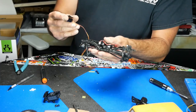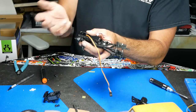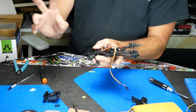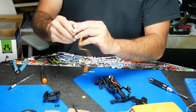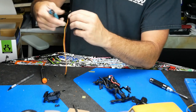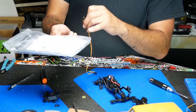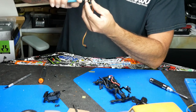Once you get that cleared, the servo goes in with the horn to the driver's side, because your steering wheel is on the left-hand side of a left-hand drive truck. If you're doing right-hand drive, just flip the servo over, flip over the steering rack, and it works that way — the horn drops on the same side your steering box would be. With the E-Max servo, you're going to want to clip the horns off the outside because they will catch on the frame.